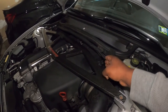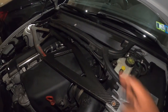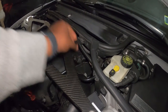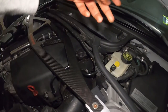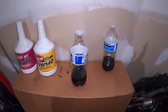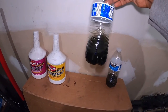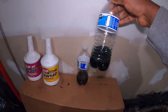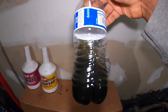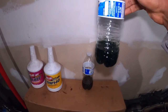One thing I also did: because the fluid that was there was actually old, I replaced the fluid that was in the reservoir — I don't want to say 'flush,' but I replaced it. I used a syringe-type tool to take out the old fluid and add new fluid. Then I used the pump to level it and ensure proper measurement, then took the car on a test drive and it works perfectly fine. To give you perspective — this is the old fluid here. It's supposed to be dark green; this is the old one. And this is new fluid — you can see it's still green here, but the old one is much, much darker. That's what was in there, and I replaced it with about the same level of new fluid.